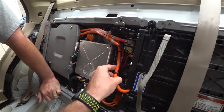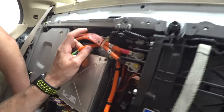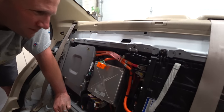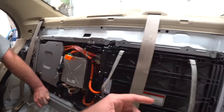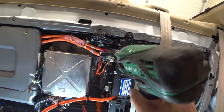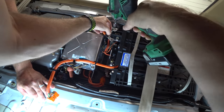This might have been worked on. We'll have to pop a couple of zip ties loose, get everything out of the way so the wiring can come with us and then the battery can come out. We also have to pull this ground right here, so we'll start with the negative positive ground.